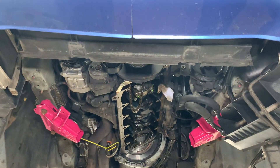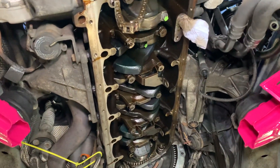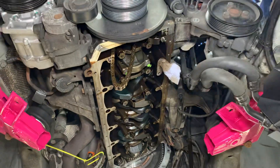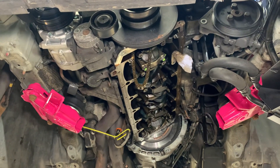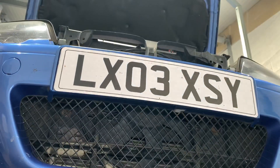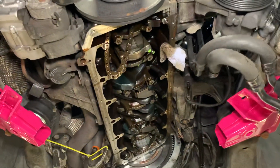When the car is further complete with the subframe and steering rack assembly back on, we'll fill with new steering fluid and fit sealing rings for the high-pressure pipes on the rack. We'll check the engine oil level and then start the vehicle for the first time, keeping the car up on the lift. We'll be stood underneath it checking, monitoring, looking, and listening as it warms up to temperature for around 15 minutes, then check the oil level again. Once we're happy, the car is fully reassembled and we'll do our standard 12-mile road test that we do on all vehicles that have been with us for conrod bearing work.